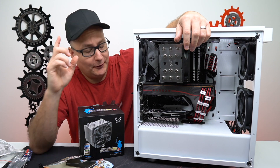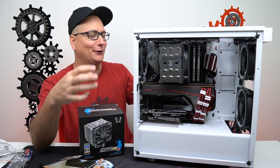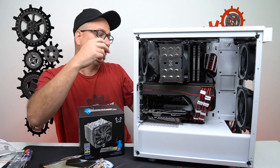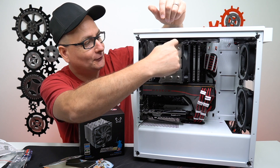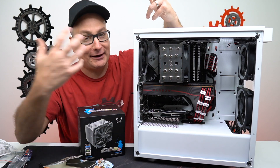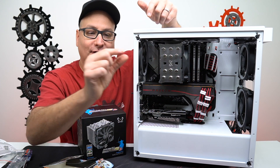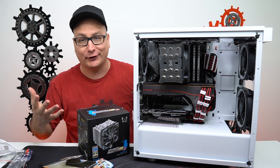We are finally done with the install. It wasn't a really hard install. The only thing that threw me off was the back plate of the motherboard fell off, so holding that while getting the mounting bracket on was the tricky part. I'd also recommend checking where your CPU fan header is first, because mine was far in the back behind the cooler — connect that before you get the cooler down in there. Also watch out — the fan sticks out just a little bit above the cooler due to the bolt underneath, but overall the install was pretty straightforward and very easy.